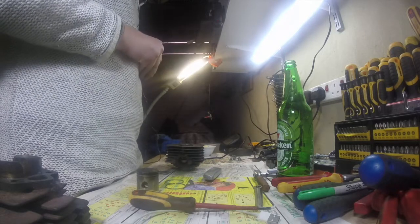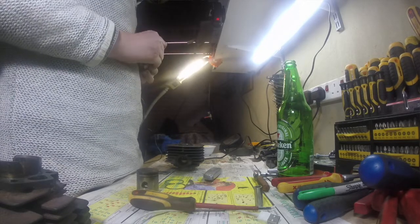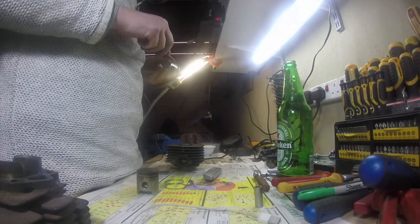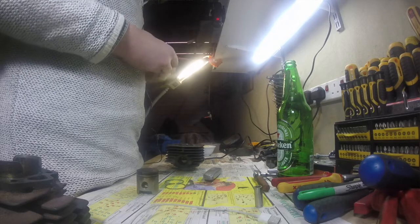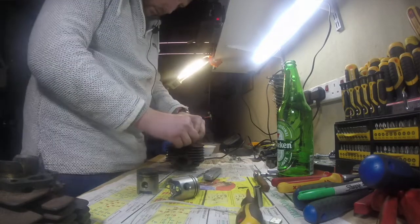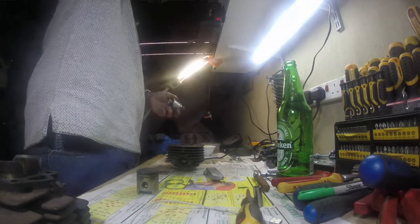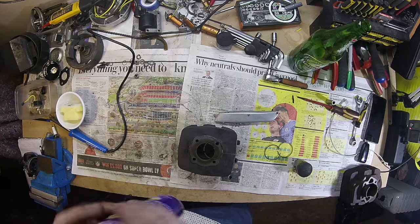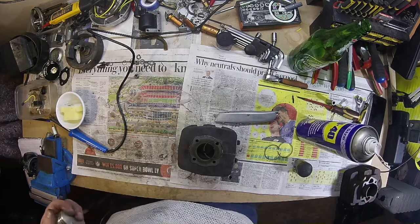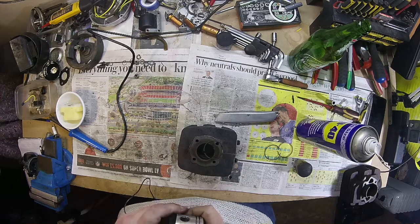Let's check this bottom one as well. I'll give this piston a clean up. There we go. Check this one — yeah, brilliant. We'll run those. So I'm going to clean this up a bit and we'll fit all this back in again. Well, I won't fit it yet — I'll fit it after it's all been ported. So tomorrow will be the porting. That's really it for now — there's not much more I can do until I've ported out that other cylinder.